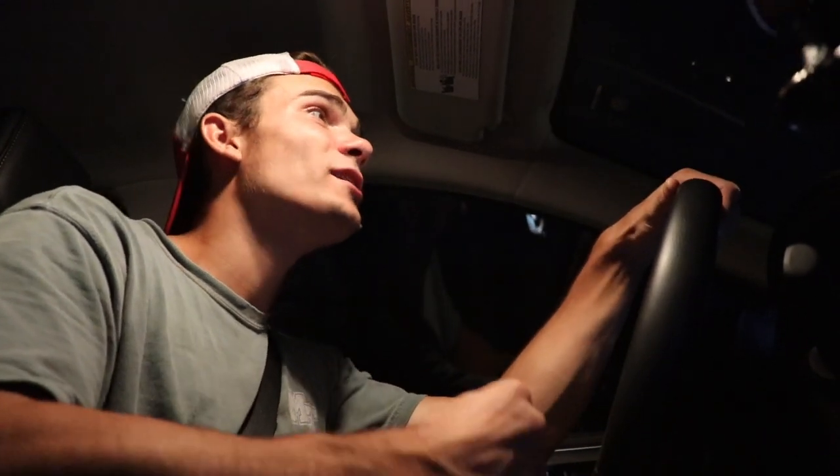Now, once again, the way that I cleaned those floorboards, I do not clean them that way every time. It's pretty rare that I have to do that. The only time I ever will soak a floorboard in degreaser and soak it with a hose and pull it out with an extractor is if they're pretty much beyond what I call the point of no return, and the only other option is replacing them. Because when you let them get to that point, there's no other way to effectively clean it than if you have some type of water source and an extractor.